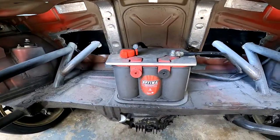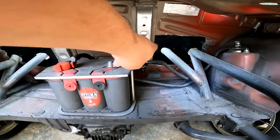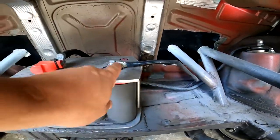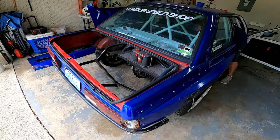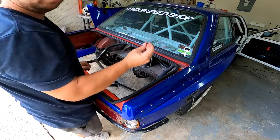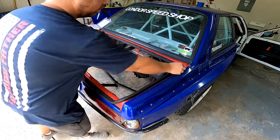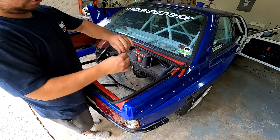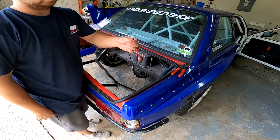So here's my battery location — it's right in the center of the car, the cooler is just right on the other side of this firewall, like 6 inches away. But what I'm going to do for the ground is just run it down through this little hole I have down here where the positive wire's already ran. I'm going to follow the negative wire and connect it right here to the terminal. So we'll route this wire from the inside of the car to the trunk, and we'll put an eye connector on here so we can hook it up to the terminal. Now the only connector that I have is one that's meant for a much thicker gauge wire, so what I like to do in this scenario is strip the wire back a bit further than I need and then fold it in half to make it a thicker connection so it will then work for a bigger terminal.